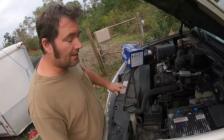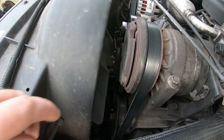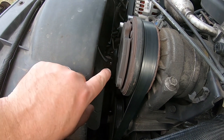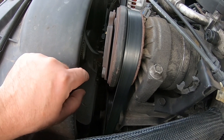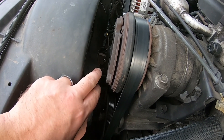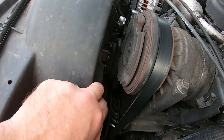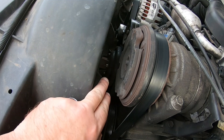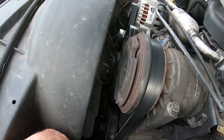As you can see there's not a lot of room in there. We've got the fan, and the clutch is on the other side of the fan. There's a big nut down there — that is a 36-millimeter nut and I do have the appropriate wrenches for that. Then you've got your nuts for your pulley. I'm going to bust that loose, take that off, take off the shroud and get that out of the way. Then we go in there, remove the belt tension, take the belt off, loosen off the pulley, take that off, and then take the water pump off. Then we reassemble everything back together.